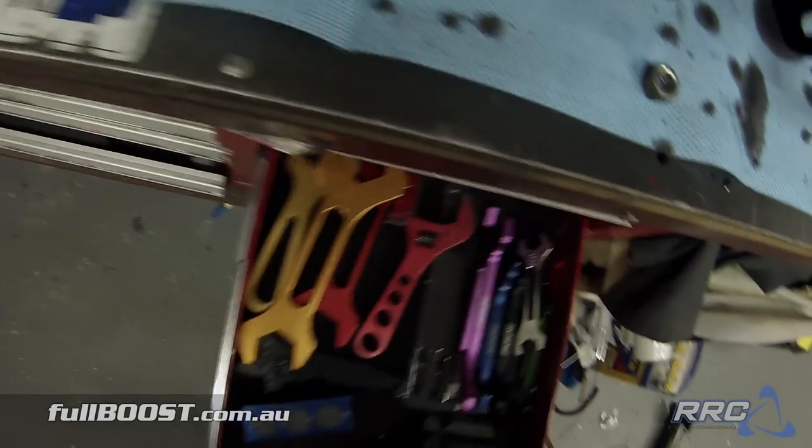Yeah, that's right. Now, AN fittings are pretty straightforward. If you use the right tools, it's a very easy job to get done. But if you respect the fittings and even put some lubrication on them when they're new, it'll help stop galling. And first and foremost, always at the end of the job, clean out those lines.